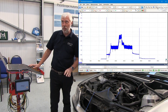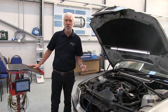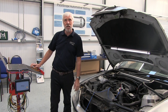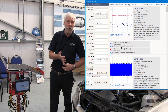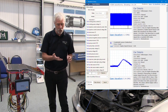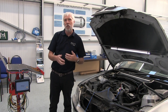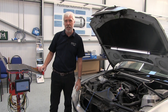This one looks good. Of course, if you are suspecting that you have a faulty sensor then your pattern may not look like the example waveform. We know this is a good sensor. We can help you with the guided tests because further down in the tests we have a waveform library where there are hundreds of waveforms uploaded by people from all over the world, and we have further guidance written by our automotive specialists to help you to the next step should you not have a waveform that matches the example.